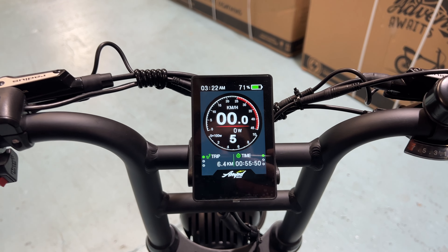If you set your clock in the display and come back a couple of days later to find it's reset and not showing the right time, that's because new displays need to be run a few times for the internal battery on the display to charge up. If you're not using the bike often, or it's new out of the box, it will take a few rides until your clock actually starts to save the time once that internal display battery charges up.